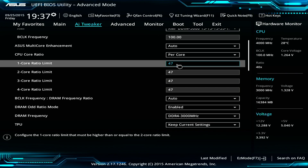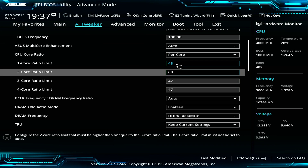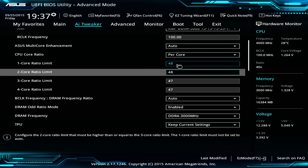On the Z170 Deluxe, which is their flagship motherboard, we ran this with an i7 and were able to get 4.8GHz on two cores and 4.7GHz on the other two. We repeated that test on the Z170A and got identical results. The fastest DDR4 memory I have is DDR4-3400. That's with an overclock of the XMP profile — the memory kit was actually DDR4-3200 and I got it to 3400 by loosening the timings a bit. The motherboard was stable with four sticks of DDR4-3400, which is pretty good.